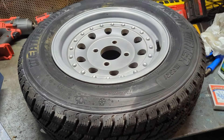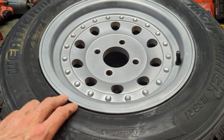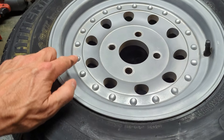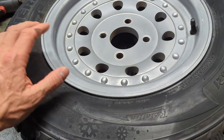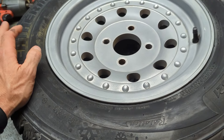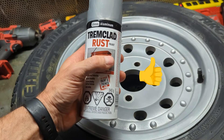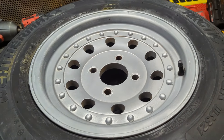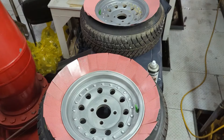Here's my rims all cleaned up. I'm going to get them ready for paint now. These are real aluminum rims — as in, they could be polished to a shine — but because of these rivets it makes it almost impossible to get around them to do a good job. So if it wasn't for these rivets I would hand polish them, but it's going to be the old rattle can. I'm going to do this again — aluminum. Let's get set up and give this a spray.